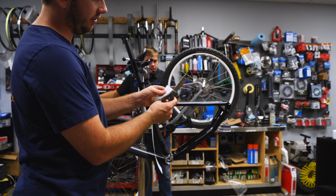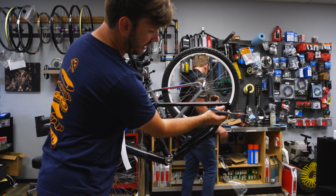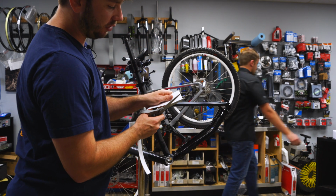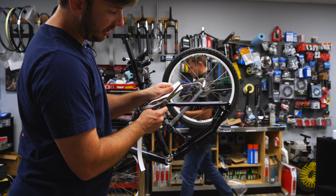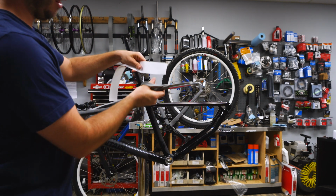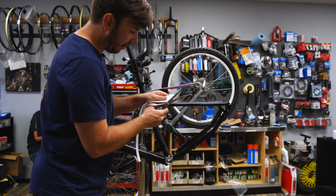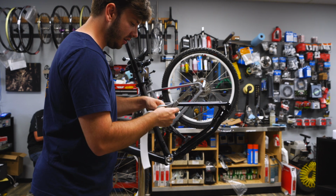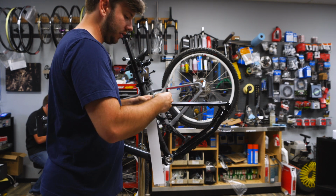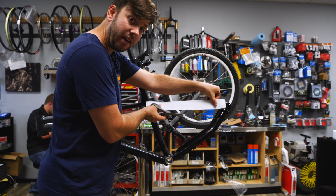So what I'm actually going to do is I'm going to take the low side and I'm going to just cut a slant in it. So right here is where it gets smaller and small enough to overlap. So that's about 2 inches. So I'm going to go 2 inches on here and I'm just going to cut a slant ever so slightly like that. And that makes it thin enough that it will not overlap. And then, as I mentioned earlier, I always like to round out those edges just so that they can't get lifted. And there we go. You can't even tell, very subtle, but that will allow it to wrap all the way around the stay and not overlap.